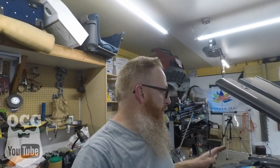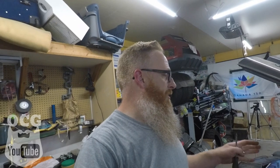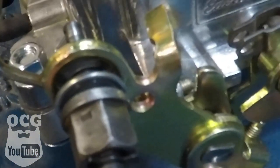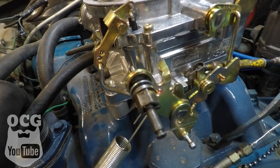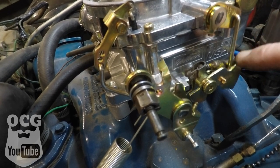If you guys remember from the first video about installing the carb — I'll link that at the end — the car was high idling and I thought the choke was stuck on. Well, in fact I believe it was. Nine times out of ten these carburetors are fully adjusted so you just put them on and away you go, and this one mostly did that. But I've run into a small problem. I was having a big gap between the idle adjustment screw and the throttle plate, and I've gone as far as removing the throttle cable, the kickdown cable, and even the cruise control, and the gap was still there.